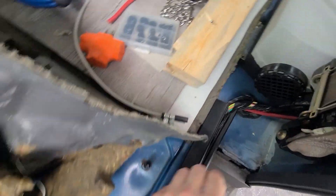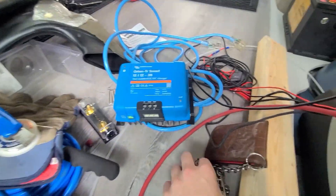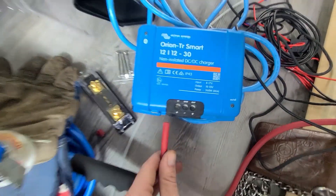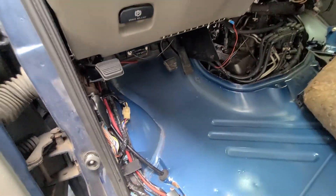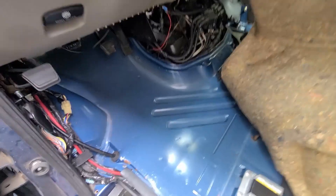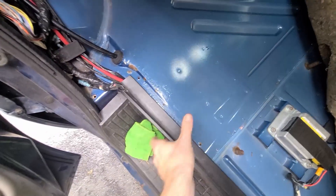Into the second part of the trough, and the Orion will be mounted up there. This is six gauge wire, which is the largest you can go with on the screw-type terminals that the Orion has. That's good to know — you can't put four gauge in, so you can't easily upgrade to a different charger later. The screw-type terminals are kind of limiting.